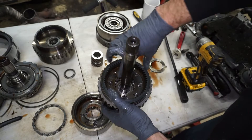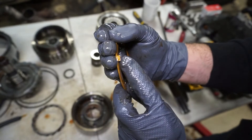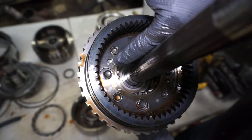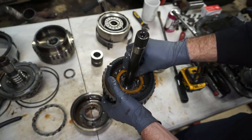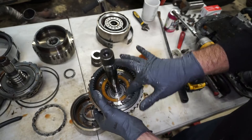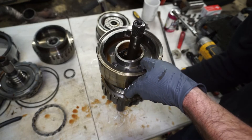I'll do a quick check — it rolls okay, don't feel anything weird. This thrust washer actually has two little tangs on it and those tangs go inside these little holes that are machined out. So those two little tangs go down and line up in these holes and then it's nice and flat all the way around.